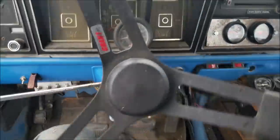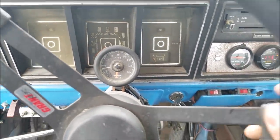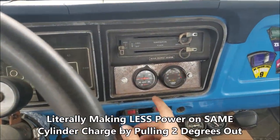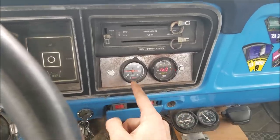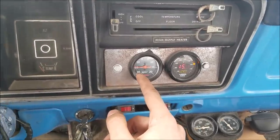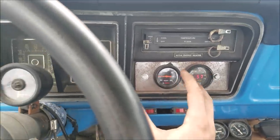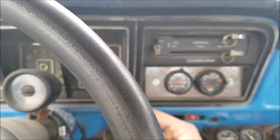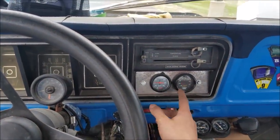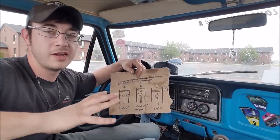Looking pretty good — we're at about 6 degrees instead of 8 degrees. We've dropped a little RPM, down to about 600. So 2 degrees cost us about 100 RPM. In dropping RPM, we altered the relationship with our carburetor, so we can see now that it's running way leaner. Even though this is a pretty stock cam that's accommodating to changes, we still did lose vacuum — we were just above 20, and now we're down at 18 or 19. So just by changing the timing on the engine, we can see it's not as efficient. There's obviously a notable relationship between ignition timing and the dynamics of an engine.